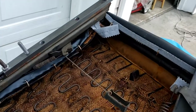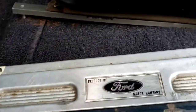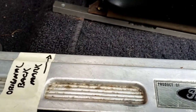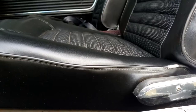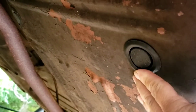Now to put it back — manhandle the seat back in, put the back in the original spot. Remember that little stud I showed you hanging out in the back? It's not going to make a difference. If you want to cut it because you don't want to see it, that's fine — but less cutting is better. Bolt those on, then install new nuts and put the little covers back on. There are four of them.